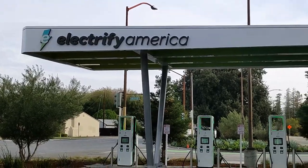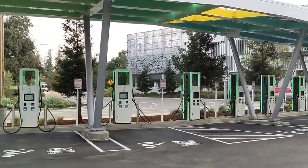There are also solar canopies here, which are awesome — though they're not fully powering the charging stations. What they do is trickle-feed on-site energy storage. This is one of the Electrify America sites that has battery storage, which helps them lower the cost of charging — they can charge up the batteries overnight when electricity rates are lower, then deploy it during the day to avoid enormous demand charges, which are a big problem with DC fast charging. The time has come — we're going to plug in and hopefully plug-in charge works. Then we'll record the whole session, analyze it, make some charts and graphs, and compare it to other electric vehicles.